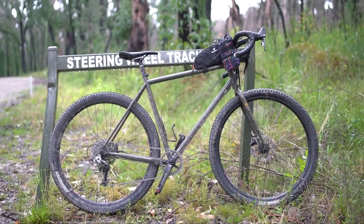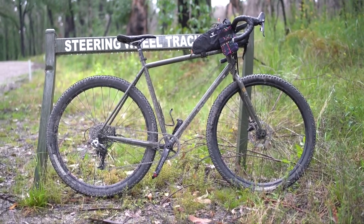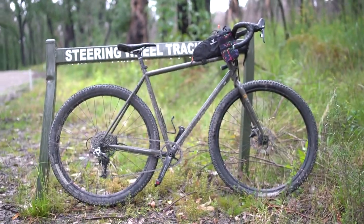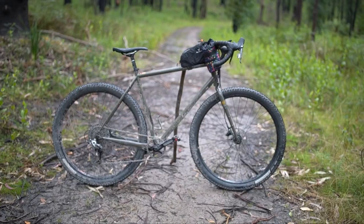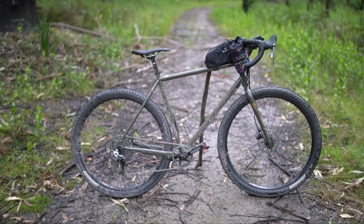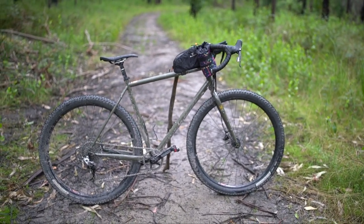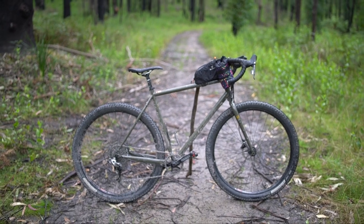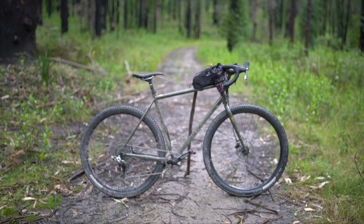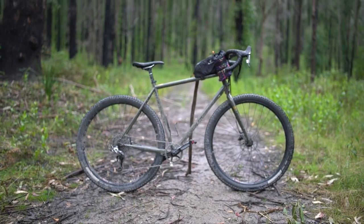If you're expecting to carry around 10 kilograms of gear, a range of 25 to 110 gear inches is a good target for a bike. This bike sits just under that at 24.5 inches, so it's pretty good if you want to ride fairly lightweight. But if you want to do off-road touring and get down to 18 gear inches, the bike is just not capable.